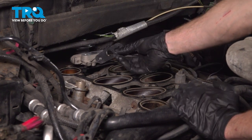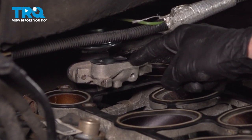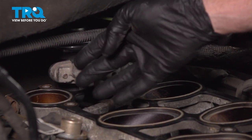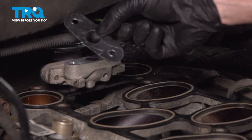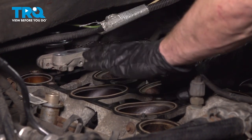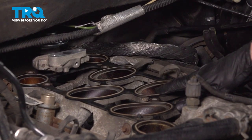Now back over at the truck, I want to talk to you about the EGR adapter gasket. That's going to be placed right in this area. But I don't want to do it before I slide the intake into place because typically this will get shifted and potentially fall either into the engine or into the belly of the engine, which is going to be a pain to get it out of there. With that said, let's take the intake and carefully put it in place. Once we do, we'll slide that gasket into place, starting each of these mounting bolts holding the gasket in place.